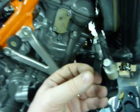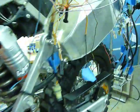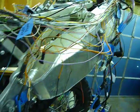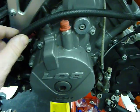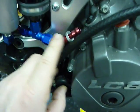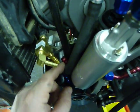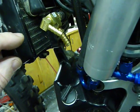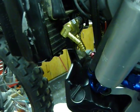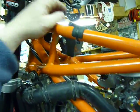And this particular bike has an auxiliary fuel cell on the back, so we got quick disconnects to replace the petcocks. Come back over here onto this side. So it's got a CJ Designs auxiliary tank on it, and then the feed line comes along here down along the frame rail, and it's going to go into this side of this T on the suction side of the pump and the filter, and then this guy tucked back in here is going to tie into this barb here. I haven't quite finished that out. And then this barb right here is going to connect into the other side of the left side of the tank with another quick disconnect. So to get the tank off, it's just going to be a matter of quick disconnect left, right, quick disconnect up here on the top, tank comes off.